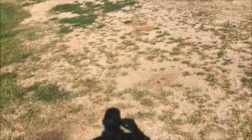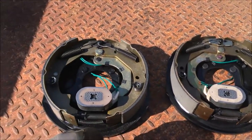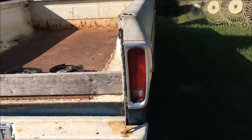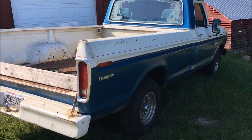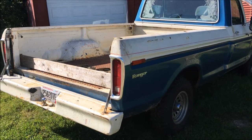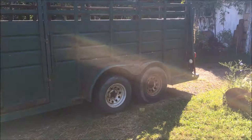I'm going to pull the back axle out from under this thing, and while I've got the axle out, before I put it back in I'm also going to put some new brakes on that axle. I got these complete backing plate assemblies on the internet — they weren't too bad, only $35 a piece, pretty reasonable. I plan on pulling the trailer mostly with my '76 F-150; I just put a new electric trailer brake controller in it. If it still doesn't feel like quite enough, I can always put new brakes on the front axle too, but I'll get this going and try it first.